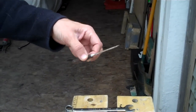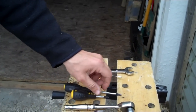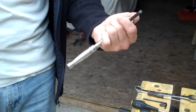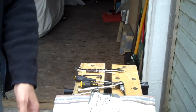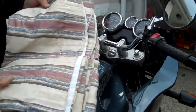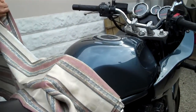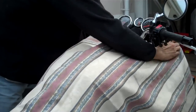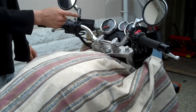The tools you need: just the tools to get the bits and bobs off your handlebars — a spanner to take mirrors off, a pick to get the little caps off, a couple of allen keys, screwdrivers, a big fat one to get the bar-end weights out, and an allen key to do up your clamps. A little 8mm socket to undo your clamps for the levers, obviously your new bars, and a really important blanket — this is a gold curtain from a charity shop, one pound. It saved so much. Just cover everything up because you're going to drop tools and scrape things — it saves your bodywork.